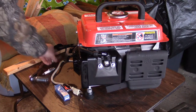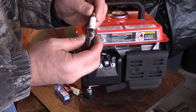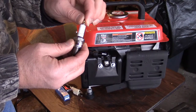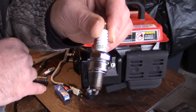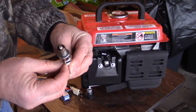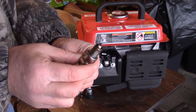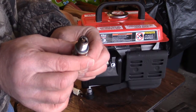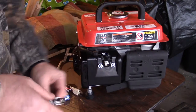To start with, this is the factory torch spark plug that was installed in it. It has green writing on it — it's called torch F7TC — and it has a screw-on terminal nut. That's kind of staked but a little bit loose, kind of shoddy construction. I suspect this is a counterfeit torch spark plug. There's a lot of spark plug companies in China, and this one is probably used because it's the low bidder. I ran this about two hours; there's a little brown on the insulator so it's not running too hot or too cold.